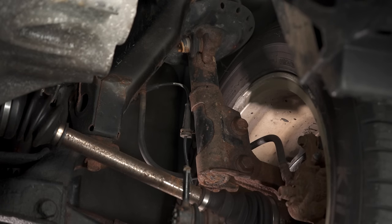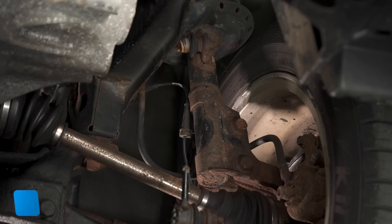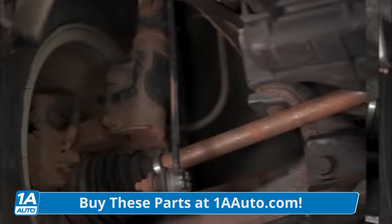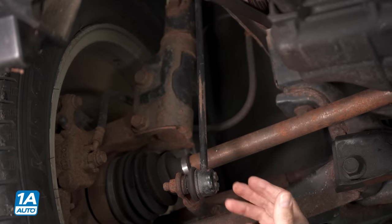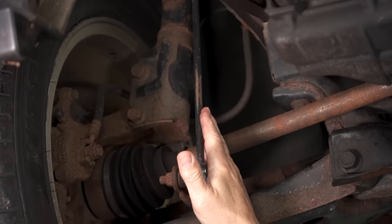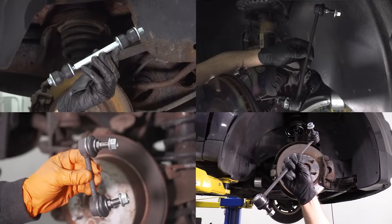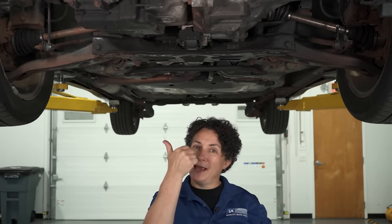So he did the right thing — it's just a matter of knowing what to do and how quickly to do it. When that happened, the noise was unbelievable, he said. He thought the wheel was falling off. Here we have the passenger side — it's still connected — so that's a good visual of what it's supposed to look like. You can see the sway bar right here, and that's a link attached to the strut. This is how they're usually set up, though some are only this big, and some go from the control arm to the sway bar. They have all different types of mounting depending on the vehicle.